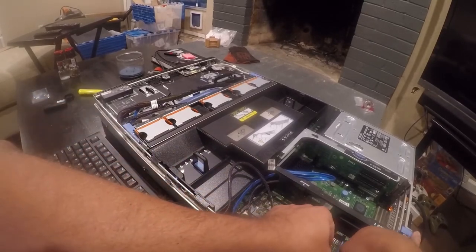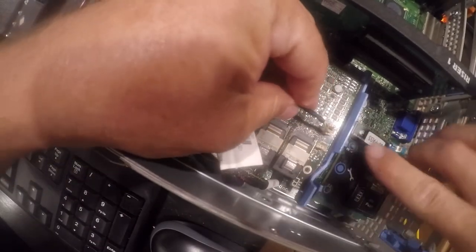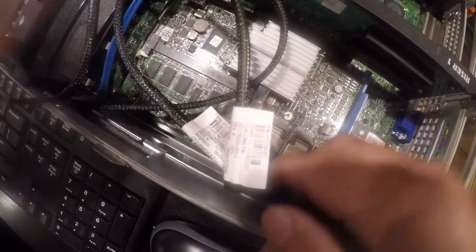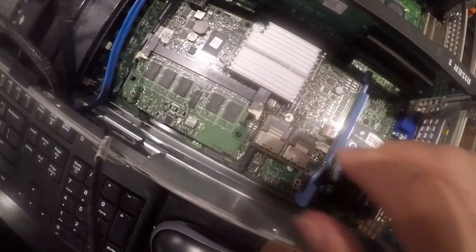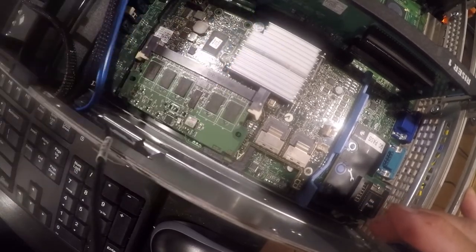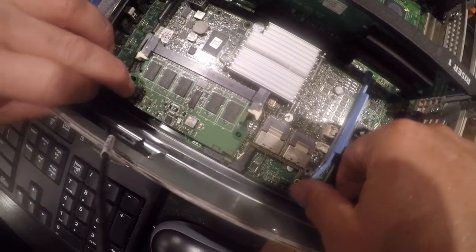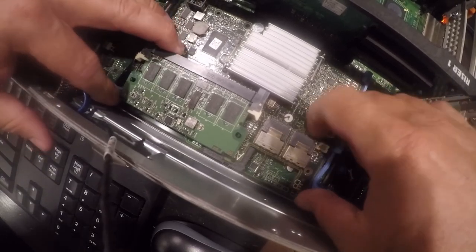The connector is a little bit difficult to get out, and the trick is to actually pull back and then it will just lift out. These are aftermarket cables that came from eBay — a little expensive but plenty long, and they will work for this card or any other card. This is a Dell DVD cable for SATA, which normally powers a DVD drive, but in this case it's not. You just pull these back and this card will pop right out.